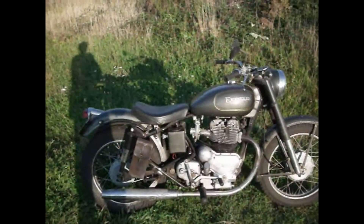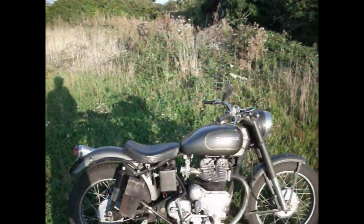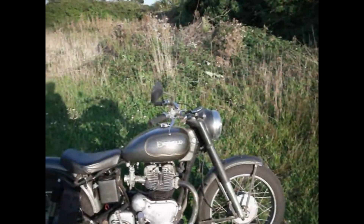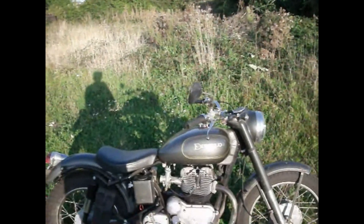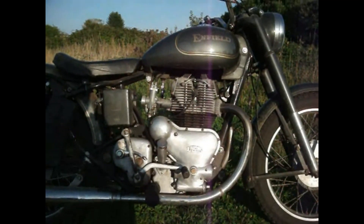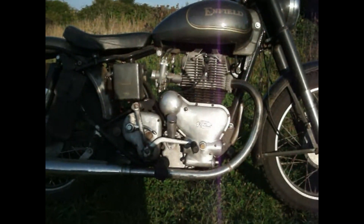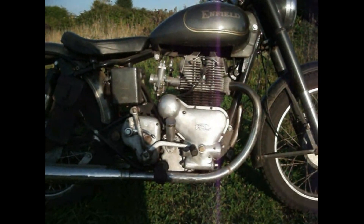Going back to this — it's got a Triumph seat on it, and it's just made out of bits really. But it's still a lovely bike. Although if I start it up you'll hear the main bearings — they're on the way out. They're massive bearings in these. Somebody put a comment about the best thing about the Royal Enfield twins being that they had four main bearings — well, they didn't. They only had two: a ball race on the drive side — a big one — and a roller bearing on the outside. They didn't have any centre bearings in the crankshaft, because that's where the massive flywheel is.